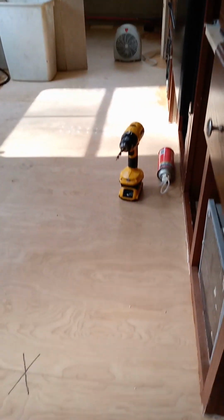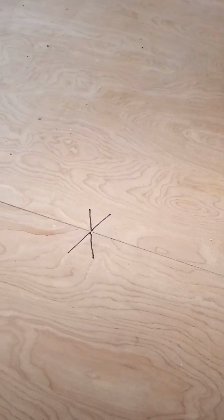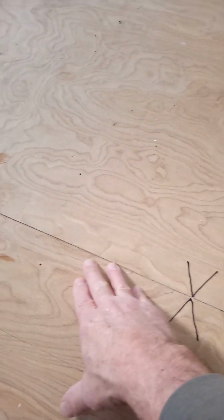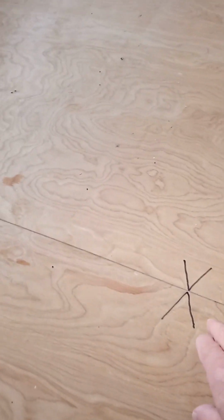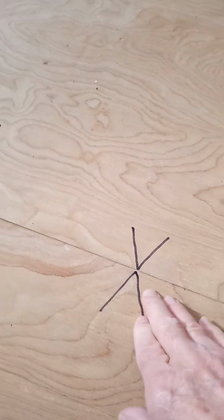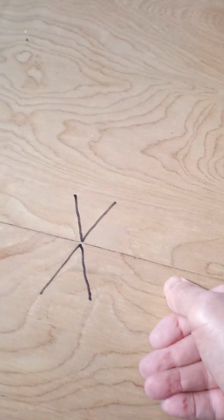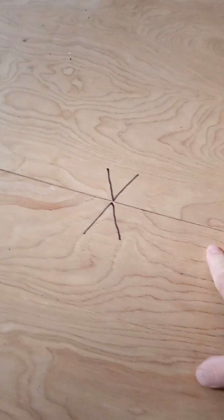Okay, so I've got the vinyl out of the camper, and I've been doing a little preliminary work here, but I want to show you where I found my soft spots, at least two of the worst ones. Right here where the two sheets of plywood they laminated over the foam meet. Let's see if you can see it, but it is moving right there. And it's pushing down. That's where my soft spot is.